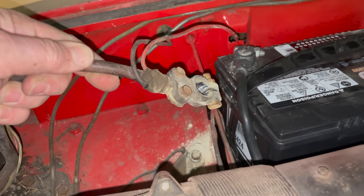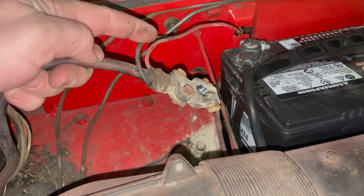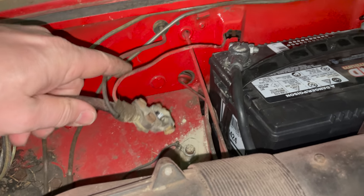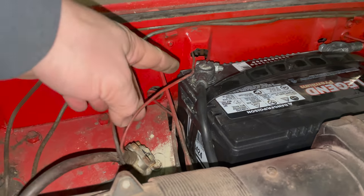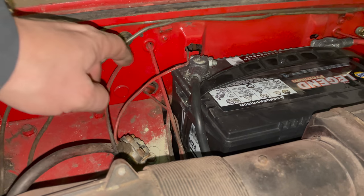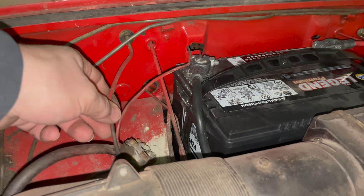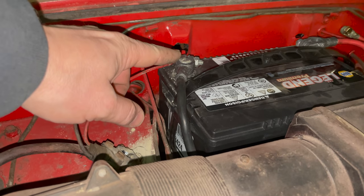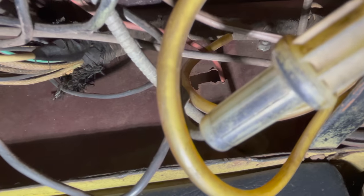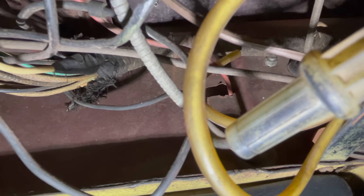Since I replaced the battery cable on this side, there were two wires connected to it, so I need to pull this apart and get these two wires out. This wire going through the rust hole in the firewall is not correct, so I'll pull that back inside the car and figure out if I need to hook it up at all. I'll get the other one, which does need to be hooked up with a ring terminal, connected up to the battery. Inside the car, that wire going through the rusted spot on the firewall - where battery acid had worn away - goes to the back of the ignition switch, so I probably do need to put a ring terminal on and connect that wire up to the battery as well.